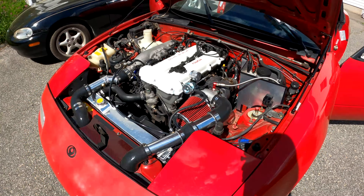This thing right now at idle is actually running pretty close to the best that it's ever run, so I'm pretty happy about that. The main thing I changed that would affect that is moving the position of the intake air temperature sensor — it shouldn't heat soak now, and that should allow it to idle much better and more consistently. I am getting some burn-off on the gasket maker for the turbo, and I'm expecting the heat wrap will start doing the same. I'm just keeping an eye on everything and making sure that everything is going well before I take this thing for a drive.